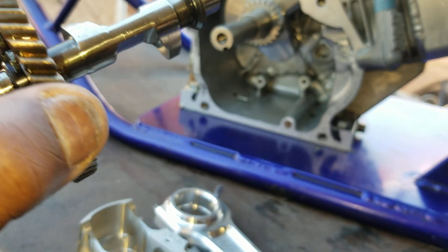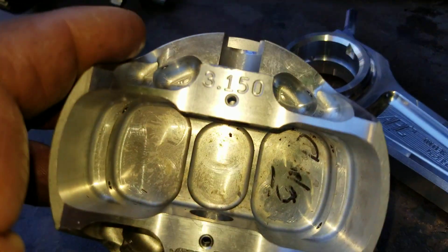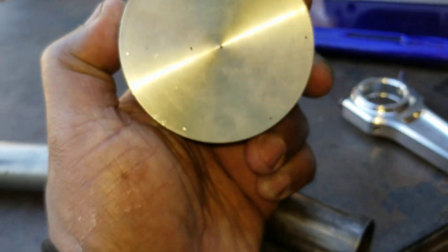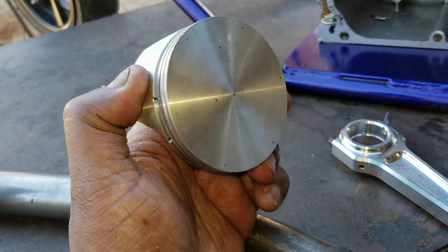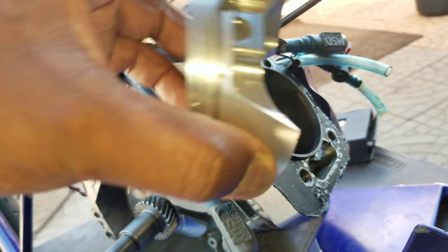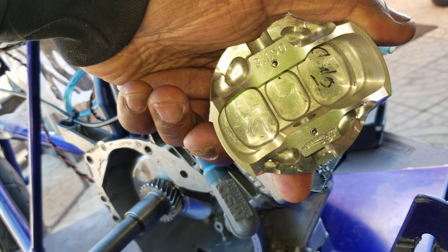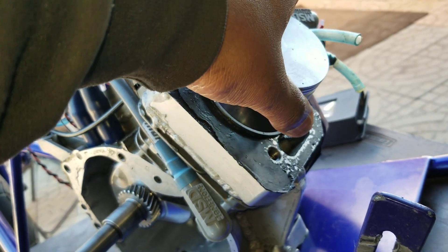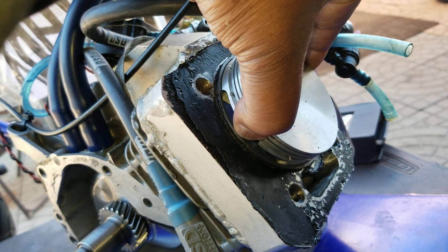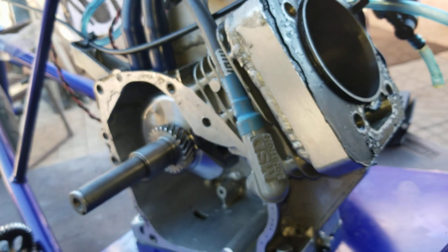See how it's done. Now this is the piston right here — 3.150. See there's an extra groove in there, gas ported. It started off as a 3.140 and I rebuilt it, now it's a 3.150. See how the piston goes in — 3.150 right bore.